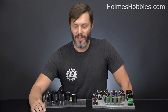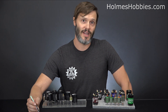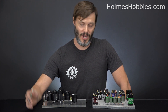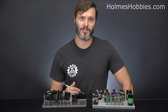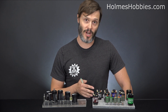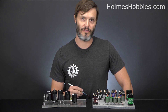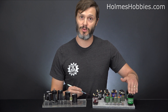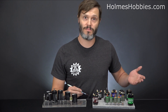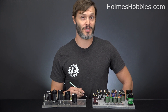To summarize: you really want to know what you want to do with your rig before choosing a motor. A few fast rules — if you want to go faster than 15 miles an hour, brushless all day. It's going to be your better solution, mostly because of brush wear. When you get going too fast in a brush motor, it just wears out brushes very fast and it's not a good value. You could buy a cheaper sealed can like the Torquemaster Sport and just swap it out, but brush motors will wear out faster, especially compared to brushless.